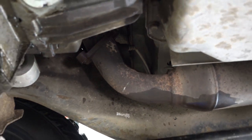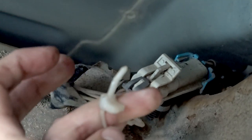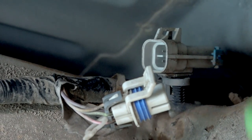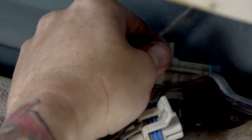There's a safety disconnect here, and if you use a pick you can get that pushed in enough to get the safety piece out. Then disconnect the sensor plug, and you have to pull the wiring out of the harness using a body tool or something similar to free it.